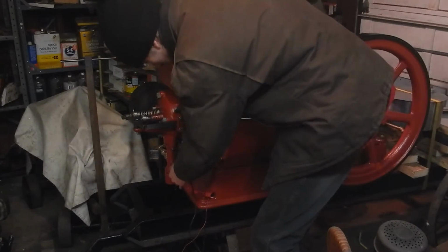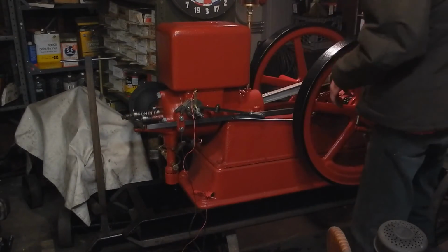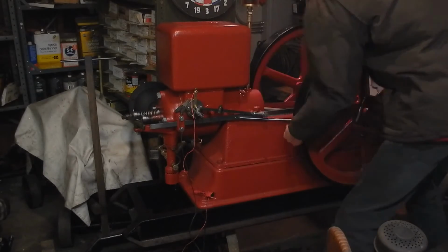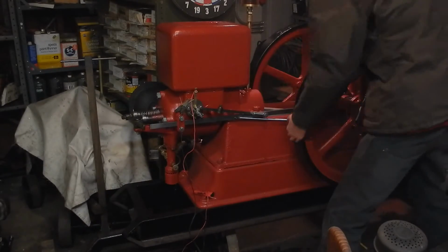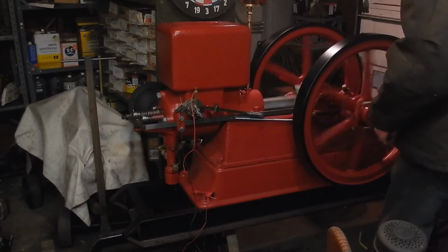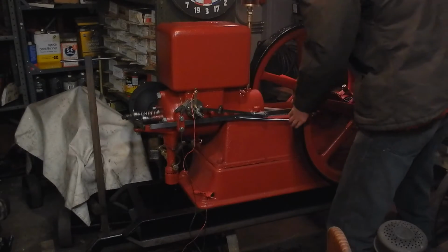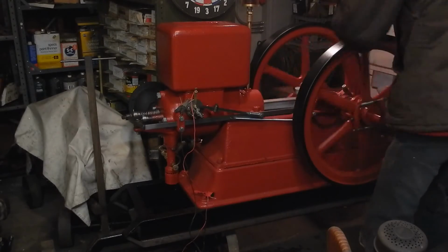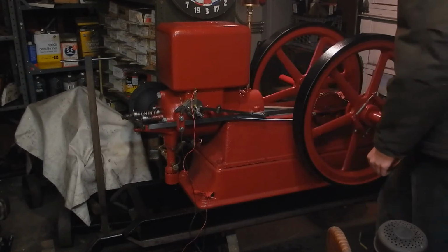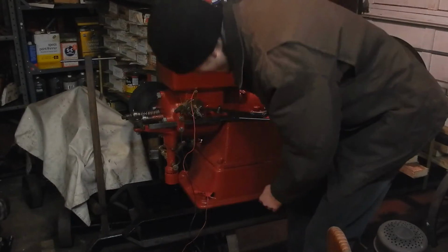Maybe I'll leave the choke off. Maybe that's giving it too much fuel. Give it a turn. The inclination is to always give it plenty of fuel, but got two hits out of it. I think I've run it too rich. I could hear gas gurgling through the rings.